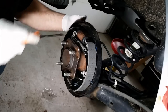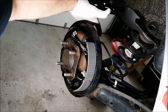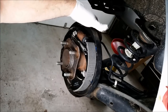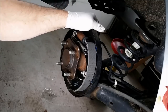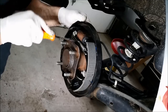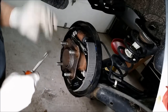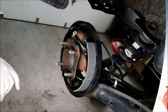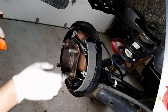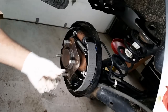This one does not have an adjustment window in the back. A lot of times you can reach right through the back here — there's an adjustment window and you reach back there with your adjusting spoon or screwdriver and turn the wheel. This one does not have one. We do have the hole in the front of the drum — I'll show you that in a minute. I'll try to get as close as I can, slip the drum on a couple of times until I know it's close, then finish it up. Put a little grease or fluid film on here so hopefully the drum doesn't get stuck on there.